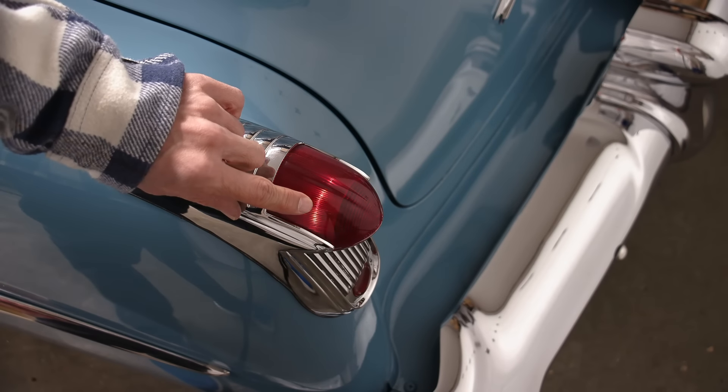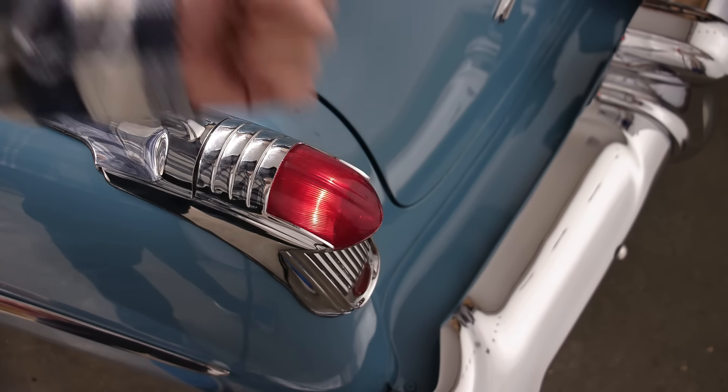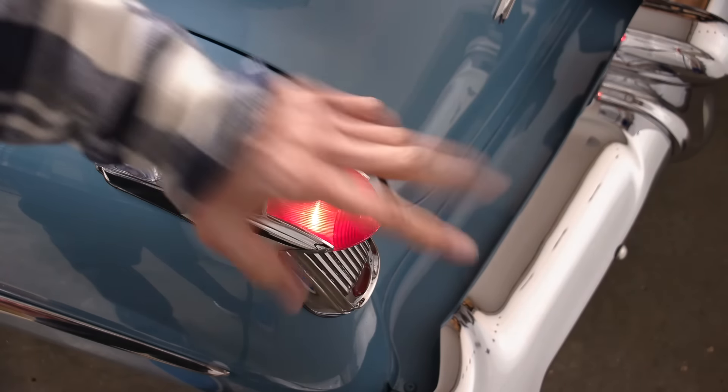Here's what the turn signal flash looks like at the rear of the car. You'll get a really good example of that persistence, or the thermal mass of the filament. You can see it's definitely not fully extinguishing and not even coming to full brightness because it's on so quick and then off. You can really see how thick that piece of tungsten is — it's taking a long time for that to cool down. It almost looks like an old tower light the way it's flashing. That definitely has to be addressed. We want a longer off cycle and a longer on cycle, and we'd like it to be more even to get the maximum amount of attention.